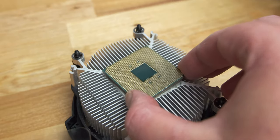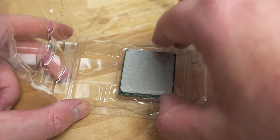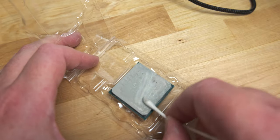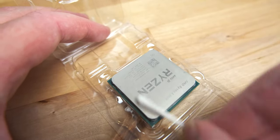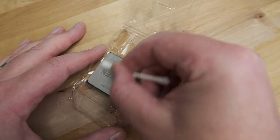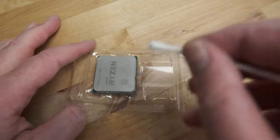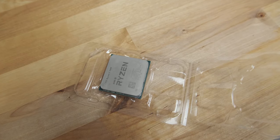Put the CPU directly back into the plastic tray that it came in to protect the pins, and wipe off the excess thermal paste with a Q-tip or a cotton pad dampened in isopropyl alcohol. Once you've removed most of the thermal paste, you can switch to a Q-tip dampened in some thermal surface purifier to clean off any that remains. I hope this helps — if you have any questions, put them down in the comments below and I'll do my best to answer them. That's it for this video, thanks for watching.